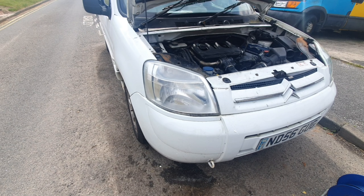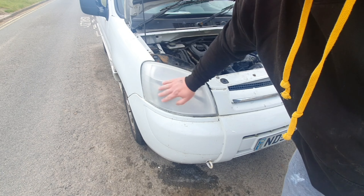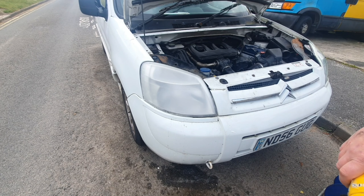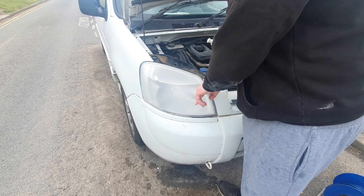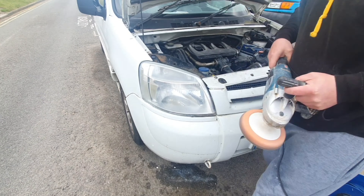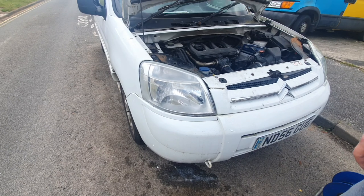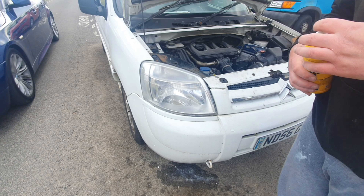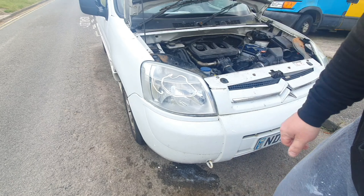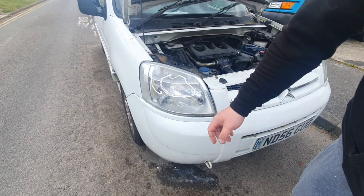Looking a lot better. I think what I'll do now is just give it another flat down again and repeat the process. I've just flatted it down again and I'm going to go back at it with the G3 compound and the buffing head — let me just wet the buffing head. As you can see it's coming up even better now. I'll put on some more compound. If your headlights are really, really bad and they don't come fully back, a bit of clear coat helps.